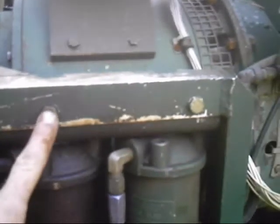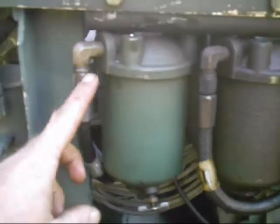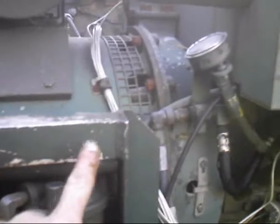What we're going to do — again, this is real easy — you've got three bolts to hold this assembly on and then two fuel lines. You've got one here, that's your inlet, and you might not be able to see it but it's back in there. It's on the back side — that's the outlet line which comes down here and goes onto the engine. What we're going to do is take these three bolts out and unhook these two lines.